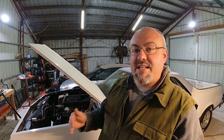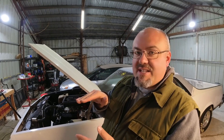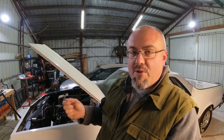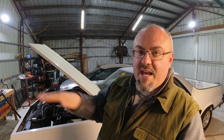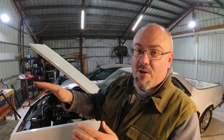Thanks to a friend who pointed that out. What that meant was I had to do something to the front end because the car was now reacting too quickly — I was getting a lot of red lights because instead of driving through the beams, the front end was being yanked vertically out of the beams. The distance was shorter to exit the beams vertically, so I was getting more red lights. Going forward was far more controlled. I tightened up the extension two clicks on both sides, and the car was then able to drive forward through the beams, and about five feet out the front end was coming up to full extension, hitting the top, and getting a little bit of light under the front tire. That was becoming a far more useful on-track suspension — working with me, and allowing me to stay green to keep going rounds.